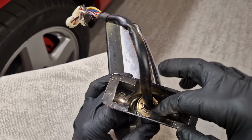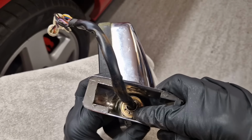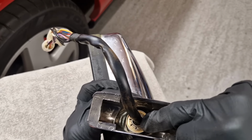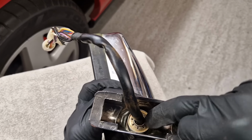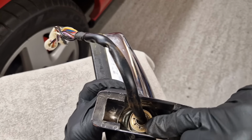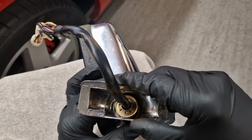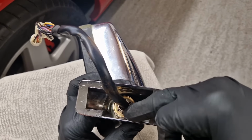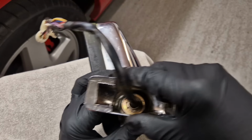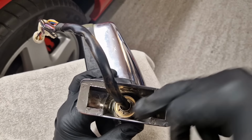And also, I might just try tapping that down now and see what happens. But my gut feeling is I might have to take this star washer off, take the spring off, push the sleeve with the spline back in first, then reintroduce the spring, and then allow that star washer to relocate again, which could be fiddly. So I think I'm just going to try tapping down on this first with something and see if... Because I'm not sure how far the splines need to go in.